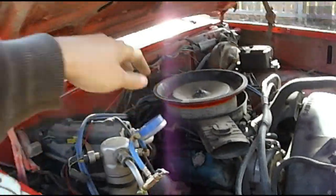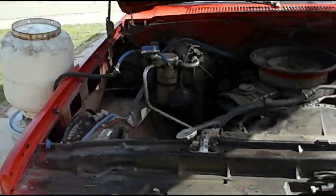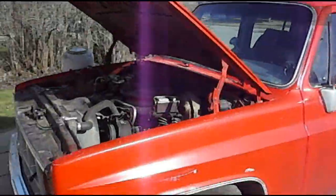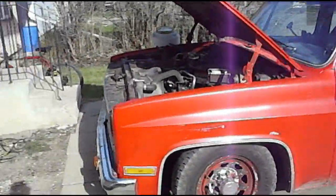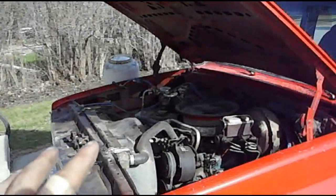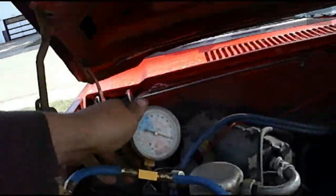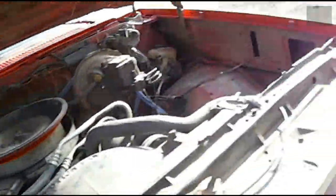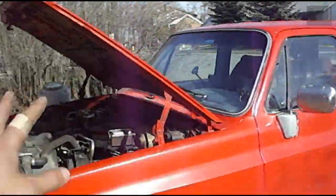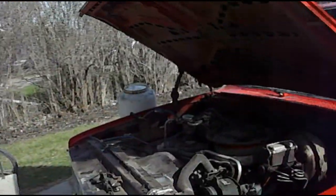Now this gauge isn't going to be accurate for the pressure with propane. It's thinking I'm using R12 or R134 with it. So to fill this around 60 psi won't be so bad. When the compressor shuts off, it should read 130 around then. Now with propane, that's not so bad. The pressure gauge ends up being off with propane in there the way it compresses.